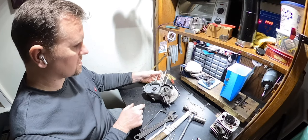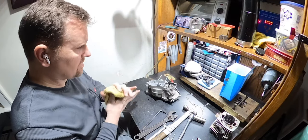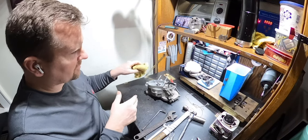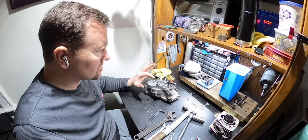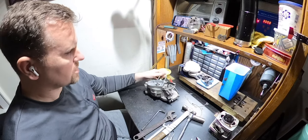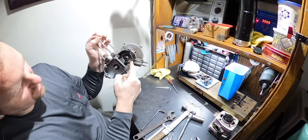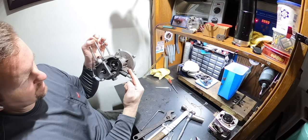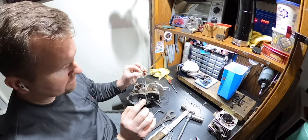I can fix these studs, because those studs are honestly a dime a dozen if you have them, but I don't have any. The ones I do have are in the same condition, but I can fix these no problem, and they'll be good. He's definitely tightening it down too high, but I'm pretty sure he said it was a bad vibration, and 100% that's the vibration. If you put your motor on where the block is not flat against the surface of the motor, and the frame tube does not sit flat in the block, you will have bad vibrations.